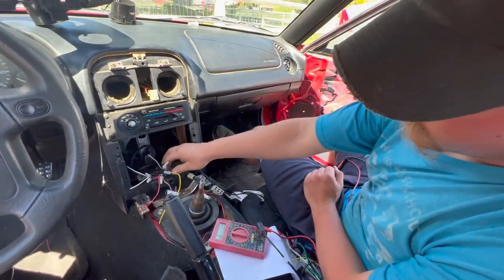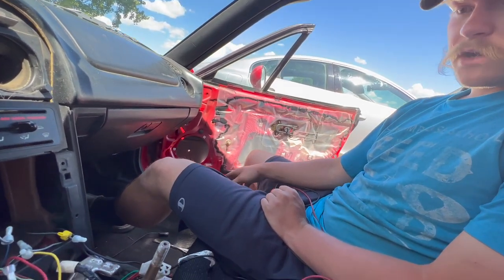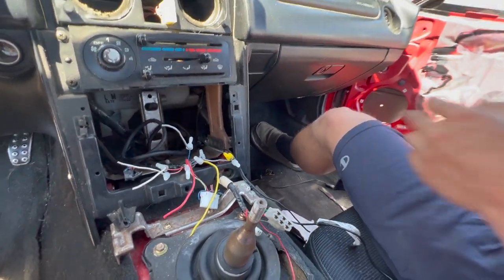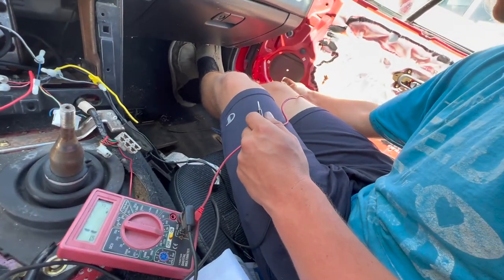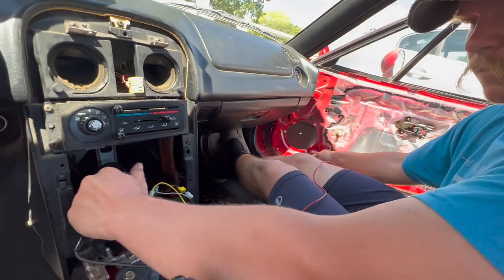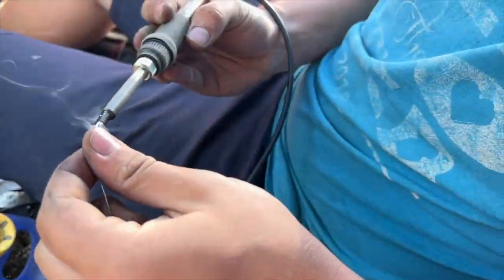Both doors have red-green and red-white wiring, but the left hand door goes to red-green and red-white over here. The right hand door goes to blue and blue-yellow. We're gonna make red-green our positive — from the factory red-green is positive, red-white is negative. We're gonna use a multimeter to confirm that blue-yellow should be the positive connection and blue solid should be the negative. Red-green is positive over here and blue-yellow is positive over here — so now we're ready to start wiring up the head unit harness.